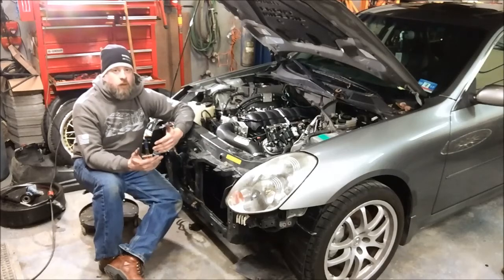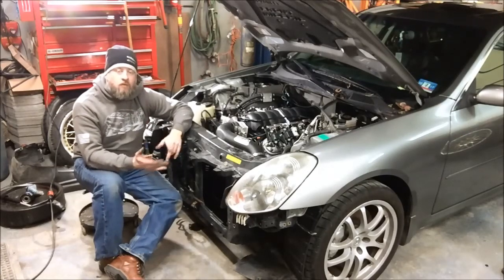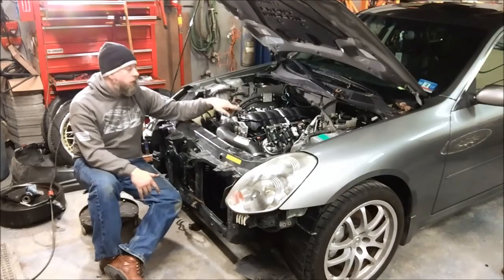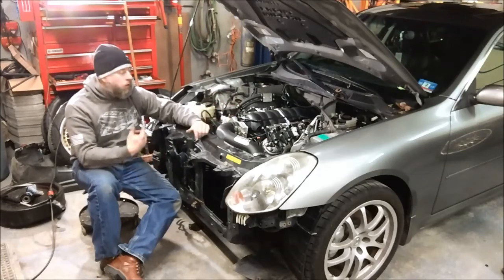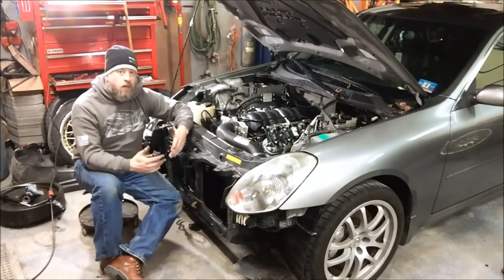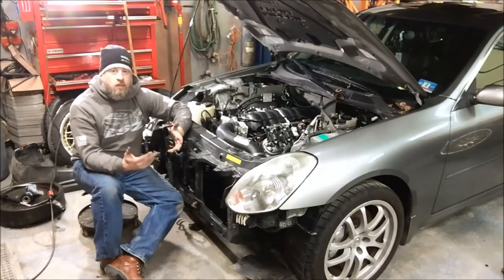When you purchase a fuel system solution from LOJ Conversions for a sedan, you'll get a new high-flow fuel pump from AEM that's compatible with E85. You'll get a new fuel pressure regulator to drop into your factory fuel sending unit that will change the fuel pressure from 51 to 58 psi. You'll get a new fuel line to connect from the factory hard line on the car to a factory fuel rail on an LS engine. All you have to do is unbolt the fuel rail and spin it 180 degrees so the fuel inlet on the rail is on the passenger side instead of the driver side. LS engines are symmetrical so that's completely bolt-on — there's no fabrication required to just spin the rail around. You drop the fuel pump in, drop the pressure regulator in, there are a couple small mods to the sending unit itself that our instructions will cover in detail. You bolt it all back together and you've now got a higher-flow fuel pump flowing more fuel at the correct pressure for this engine, so you don't have to do anything in the tune to downgrade the effective injector size.